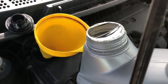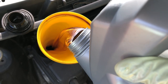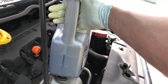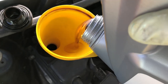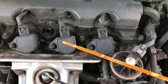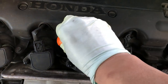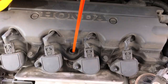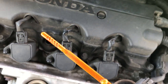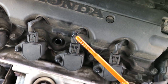Keep pouring. Check again — maybe three quarts in there. Pour a little more, then stop and check the dipstick. Pull it out, wipe it down, dip it back in all the way to the bottom, and pull it out. Check that the oil level is somewhere in the hexagonal area on the dipstick. It's near the bottom of the hexagonal area — we're actually okay. Top it off just a little more and we'll call it a day.